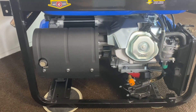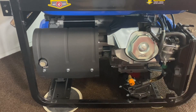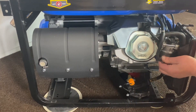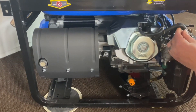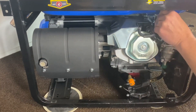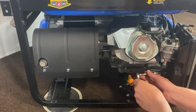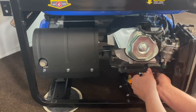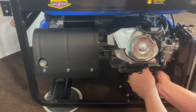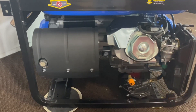First, we're going to go ahead and remove our air breather tube going to your gasoline tank. Just kind of tuck that to the side. We'll go ahead and pull this tube out here and tuck that back up out of your way too. You have a vibration bracket nut back here — we'll go ahead and remove that. That'll take care of all the steps on the back of the unit, and then we'll show you the next steps on the front.